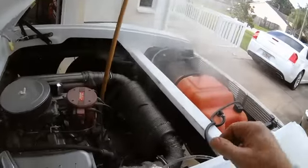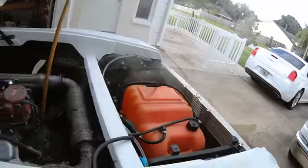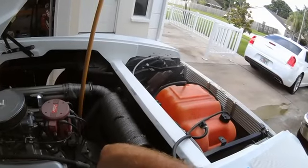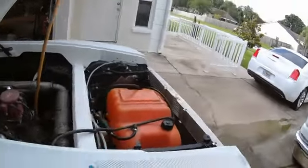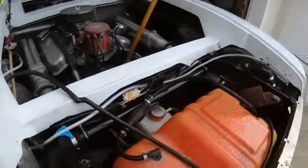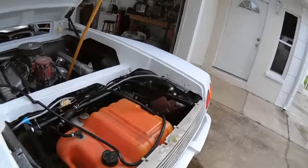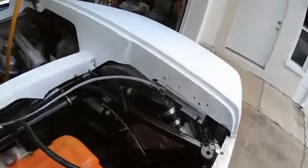The vinyl hoses didn't seem to want to hold up - so that was a bad idea. But I do see fluid coming in there so I'm going to relieve the pressure here. Well that was interesting - I didn't have any clamps on those and didn't really expect it to get this hot. But looks like the thermostat just decided it wants to open up real quickly. Yeah that's nice and hot - that radiator is nice and hot. Anyway, averted disaster there, got it shut off. So it looks like that vinyl might work but I can tell right now it's warm and it's softened, so that's what's happening. I'll have to put some clamps on it - my bad.